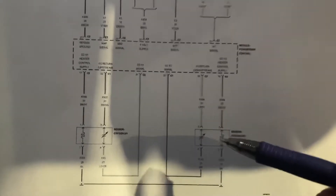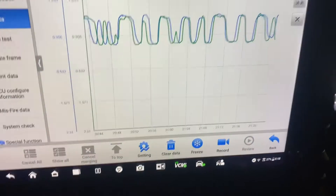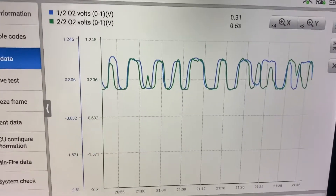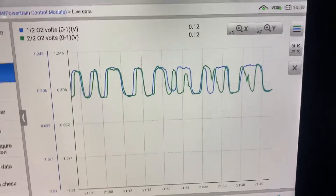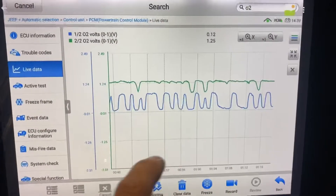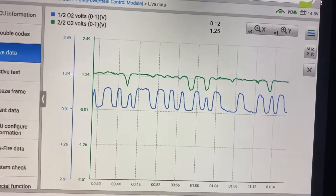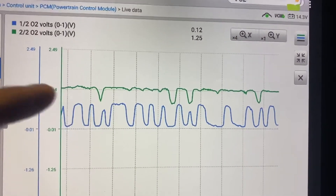But in that case we don't have this signal — we have the signal but with some voltage. The ground voltage right here. I already fixed it. This is the real waveform without issues — this is a beautiful waveform. Now let me show you what happened with a bad sensor. Right here, in this picture, we have 1.24 volts, and that's Bank 2. This is the issue.